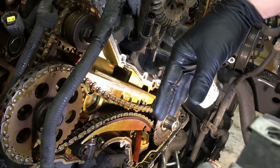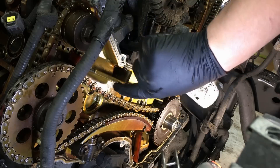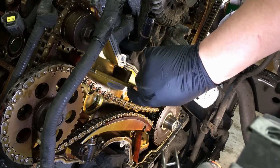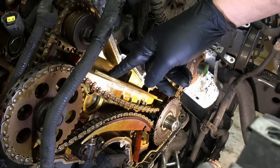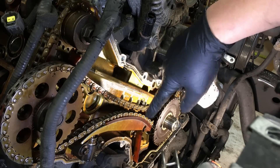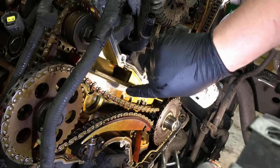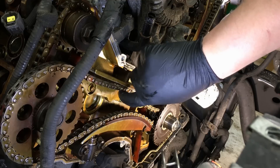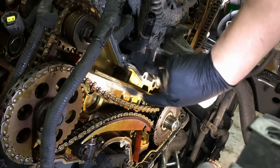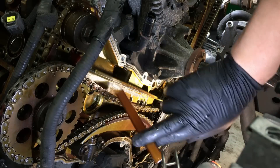You could hear it was quite loud on this side — that chain dragging type noise. And that's why: the guide on this side, the plastic guide, is totally gone. This is very common — the guides always break on this side, whether it's the newer engines or the older ones like this with the aluminum-backed plastic guides or the new all-plastic guides. It always seems to be this side when it cracks. If you've got a chain-type dragging noise, passenger side, this is what's going on. It's extra loud on these because this is aluminum — it slaps and drags across it. You can see wear in the metal, and here's a big piece of the guide right here.